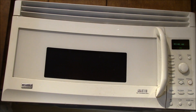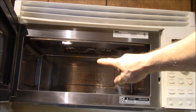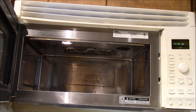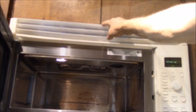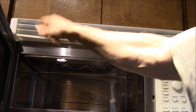There's a light inside the oven that turns on when you open the door, right up here. It's a 20-watt halogen bipin bulb that I've had to replace once in about 10 years. I probably wouldn't use an LED because this bulb is inside the oven compartment — it gets really hot and an LED wouldn't last long. It can be accessed through this front panel: two screws on top, pull the panel off, and you can get to that bulb.